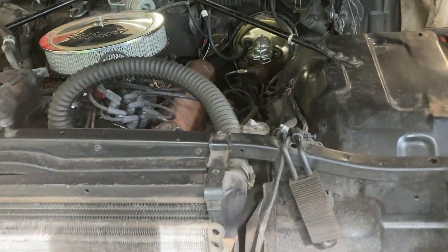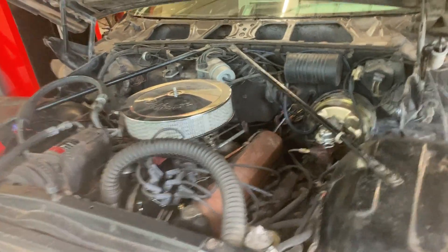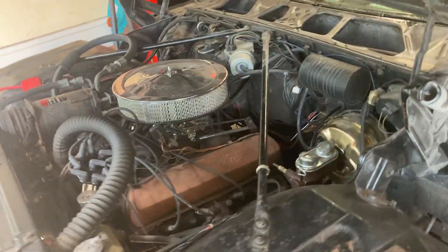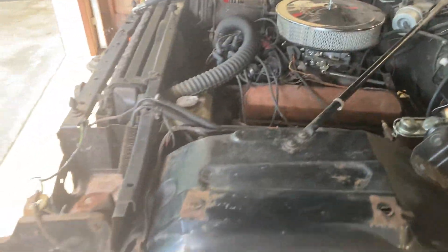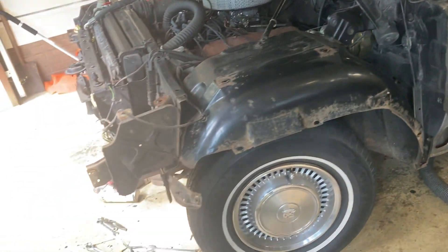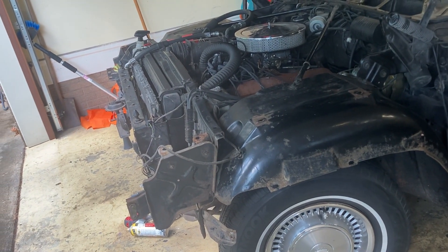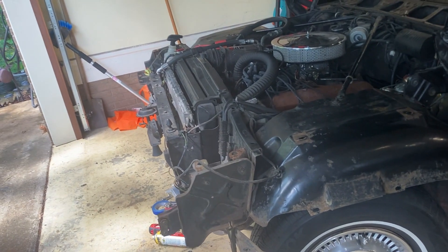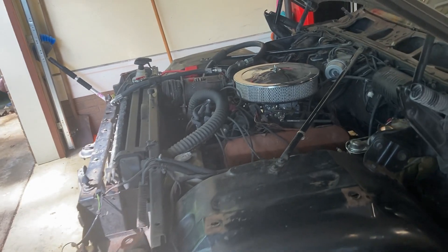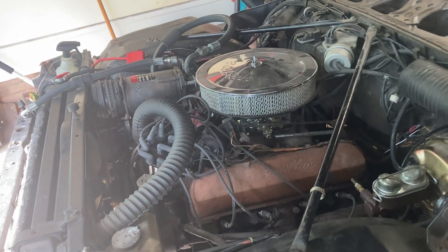The one from my parts car also had rust in the battery tray. So I'm going to keep on disassembling basically and peel away the parts until I get everything off the front end here. I'll take the fender wells off, radiator support — I'll have to drain the radiator — then eventually get to the point where I can pull the engine out.